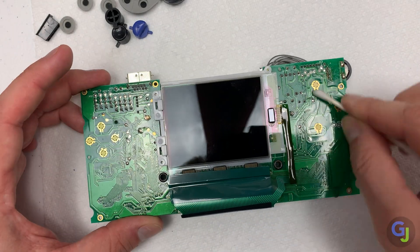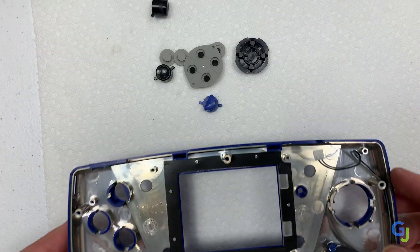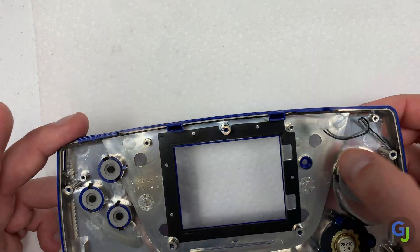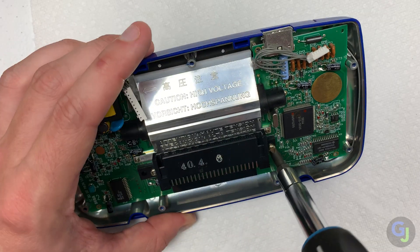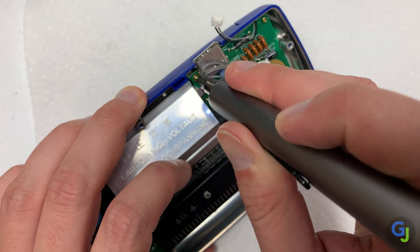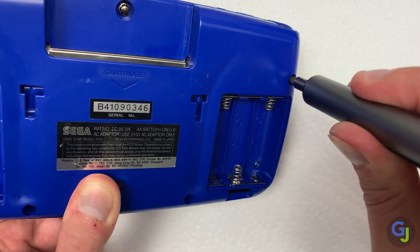Let's do a quick wipe down of the main board too — we're here and it might as well be as clean as possible before we close everything up. On to the final assembly. Put the buttons and pads in first and make sure they are seated properly, otherwise they will pop out of place when you put in the main board. One quick note though: the wire for the speaker goes under the main board and is fed up around the pins in the shell. Make sure you don't close it up behind the main board — pop it out the top instead. Continue to reinstall all the screws and cables in reverse order. Before adding in any outer screws, if you're having trouble closing it up just wiggle both sides of the shell and it should pop into place.